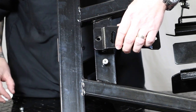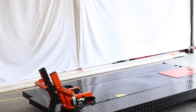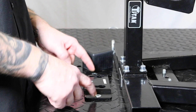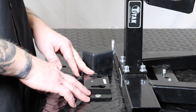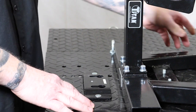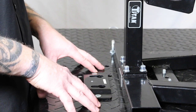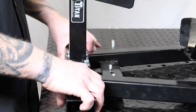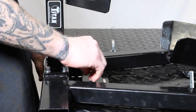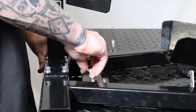I'm going to get these bolted down to the lift right now. I've taken the stock orange wheel vise off the Titan 1000D and put the quick detach plate right here, running the two bolts through with lock nuts on the bottom so it's all secured to the nose of the lift. A little trick: make sure you take off these rubber end caps — when they're on, they raise it up and make it very difficult to get it into the plate. With the hardware mounted, you can lift it up, drop it down into the large holes, pull it forward, thread the wing nut down, and get the lift secured down.